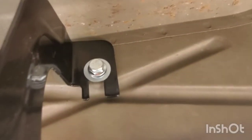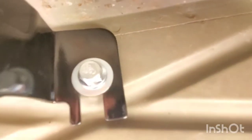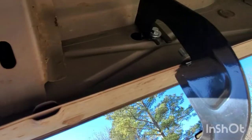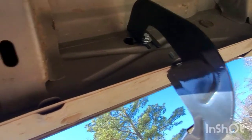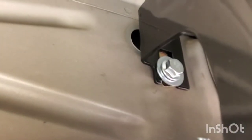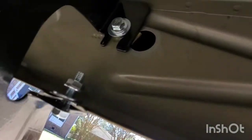So this is the bolt and washer setup I have: your supplied bolt with the washer underneath the bolt head, and another washer on top of the body because all your pressure is going to be right there from stepping on it. So I'm going to wash, rinse, and repeat for the other four mounting holes and get all the brackets on. This is how it should look when you're done — brackets one, two, three, and four, with the third one towards the back being more towards the bottom where that hole was drilled.